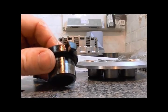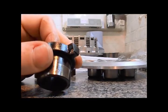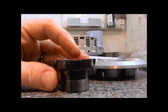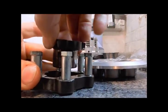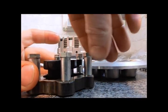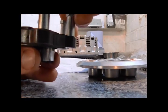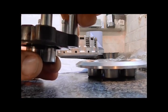This engine's at about 11,000 miles. There's slight wear — that's the working edge. Slight wear to the bottom. I don't know what this bike rode like at this point — I've never actually ridden it. I bought it with a knackered engine, I've just taken the engine out and I'm putting it back together again to fix the third gear on the output shaft — one of the teeth on that cog stripped off. I've managed to save the engine; I think it hasn't done too much damage. Even with the wear — and I think that's probably normal wear — it seems to slide fairly nicely, it's not notchy at all, so I'm guessing that's going to be okay.